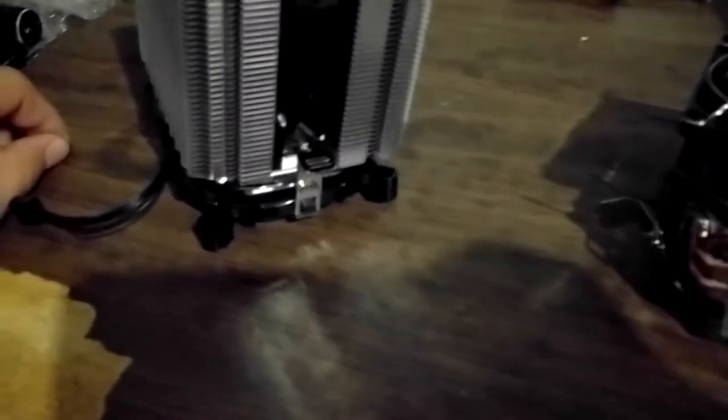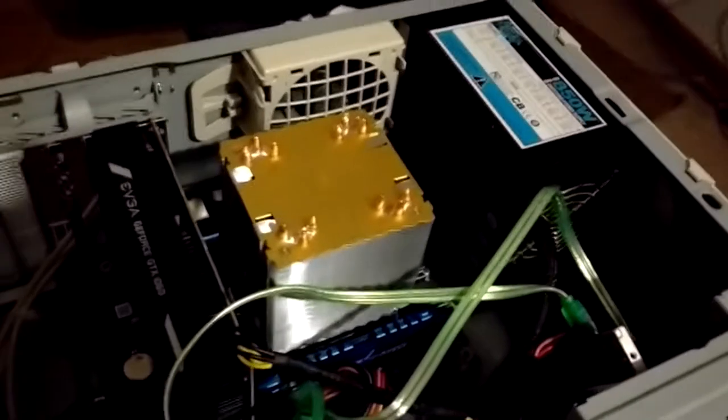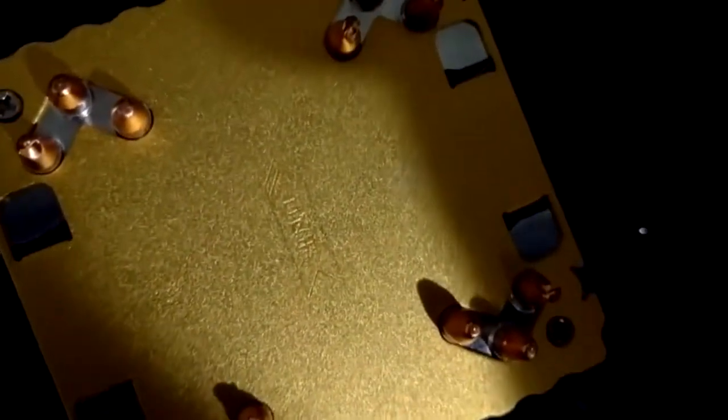As far as mounting, it's really pretty standard. You stick the cooler in the slot, hook that one in, and then on the other side it's typical AMD mounting. I bunged it up there — you just kind of push this one down until it latches. Since I can't do that with one hand in the case, I'm going to do that off-camera. She is installed, and one thing to be very mindful of is that little arrow there showing you the airflow direction. I did compare the fan orientation with that arrow to confirm it is pointing in the right direction.